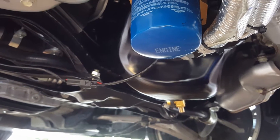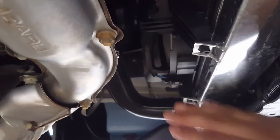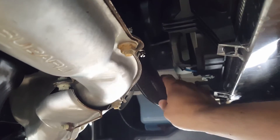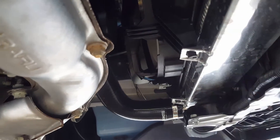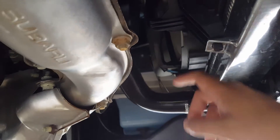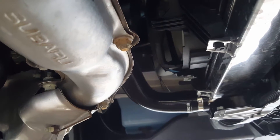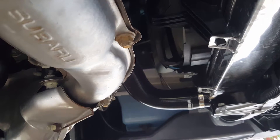The water was spiking up to 220. I came to realize that I had a small leak on this particular hose. I did a poor job originally cutting this down to size. I'm running a Mishimoto X-Line radiator, which I love — it's very efficient. Now that I fixed the leak and tracked the car, my temperatures don't go above 195, maybe 201 degrees for a few seconds down the straightaway.